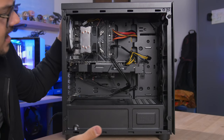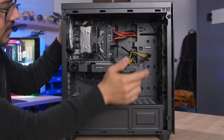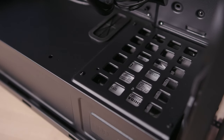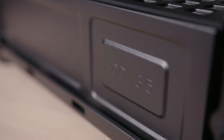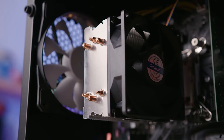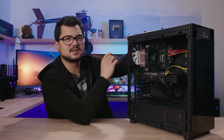A lot of people might not even notice the cable management issues — they just might think this is what a gaming PC looks like. The layout of this case is pretty straightforward. There's a power supply shroud, which is nice, and there's a rubber grommet in the shroud that they did not use — they could have easily run the video card cable through it. There's an interesting grid pattern on the front of the PSU shroud that gives you a view of your mechanical drive. The CPU cooler, as I predicted in the first video, is not an Intel stock cooler, which is good. At the very least it's not that — but it is a fairly entry-level, dinky-looking cooler: a small heatsink tower with a 92mm fan.